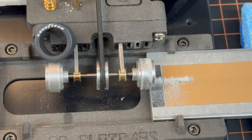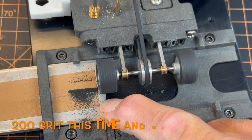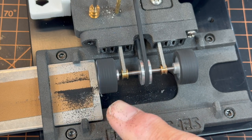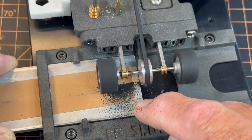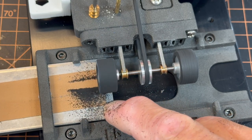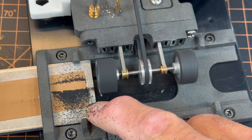With the stock tires on, it doesn't take a whole lot. I'm using the 200 grit option, just a little pressure at around seven volts, and you can really cut through this rubber pretty fast. It's a little more pressure than I usually use — I'm just showing you how fast you can turn these down. You don't want to overheat them, but it doesn't take very long and you're going to have this tread design cut away. Nice and true, tread design will be pretty much gone, giving you a smooth tire.